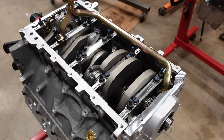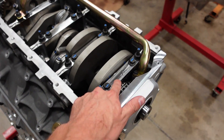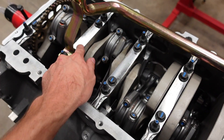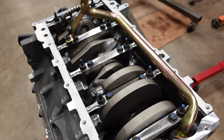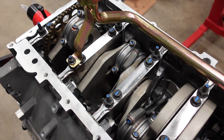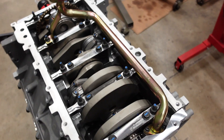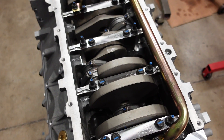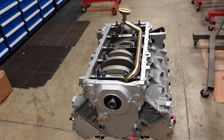Here's one last look at the rotating assembly of this beast. To recap: we have a true LS7 GM block with the doweled billet steel main caps. We have our Smedding 4340 forged 4.125 stroke crankshaft, fully internally balanced. We have our Smedding power adder H-beam 4340 forged connecting rods with ARP 2000 rod bolts. And making all of that work are some beautiful custom JE 13.2-to-1 compression forged pistons. Next, get the oil pan on, and then we can finish the valve train.